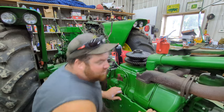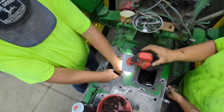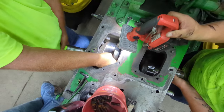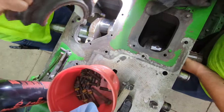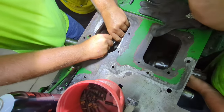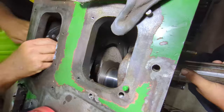Just going to be careful because it's sitting on that spot. Now we can get that bearing put in. So dad's got one half of the main bearing in the center down in there. Let's try and get the bolts back in it. Tyler's got the other half. This does have some dowel pins on it. We've got to get that in, tightened together on the crank, and then work it into its spot.